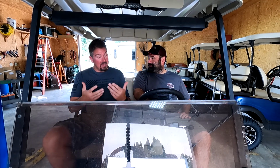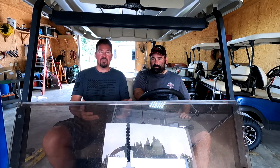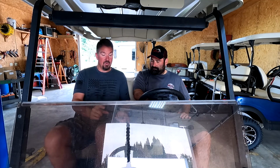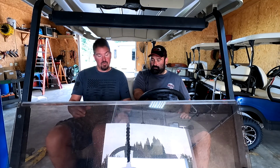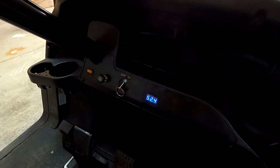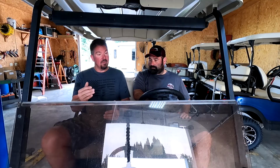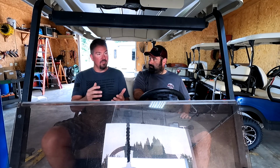And that's pretty cool though, because then we can hook up the charger, recharge this up, and there were a few modifications that you did put in this, which made sense. So he turned around and put a voltmeter in here, and we found what the top of it was, and we also found that the bottom is right around 11 to 11.3 volts per battery.